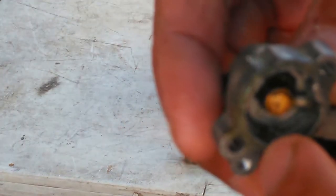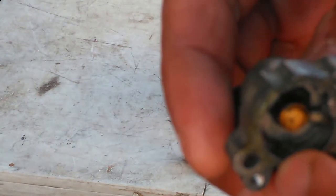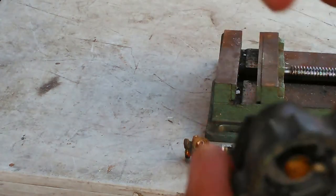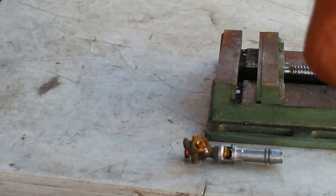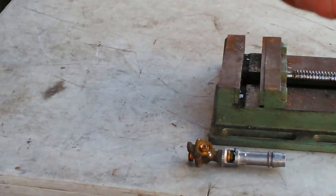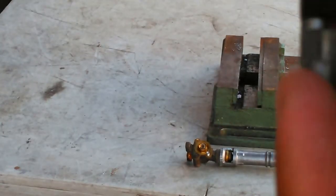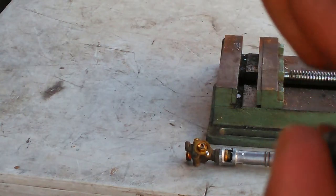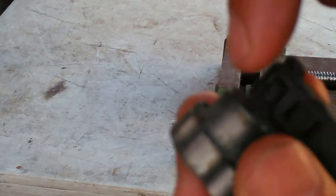There's a final lock here — that's full open. Obviously this pushes down, it pushes on the spring, and then you push down and it starts the stove. Once I got this open, I discovered that this should turn freely, and I discovered that this is binding in here because when this got damaged it bent the rod.